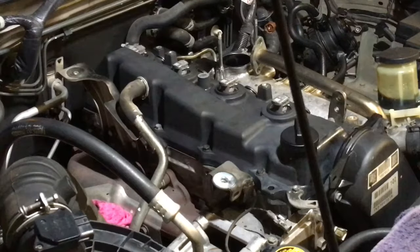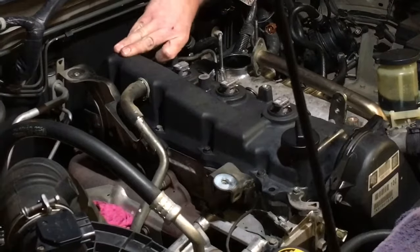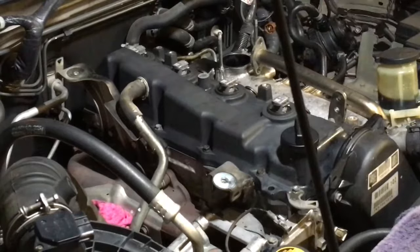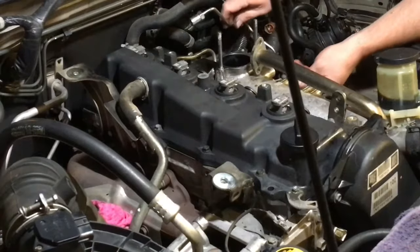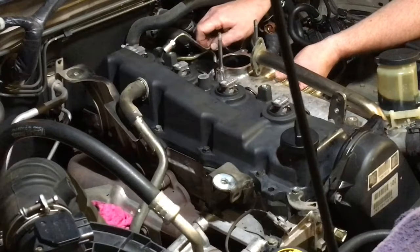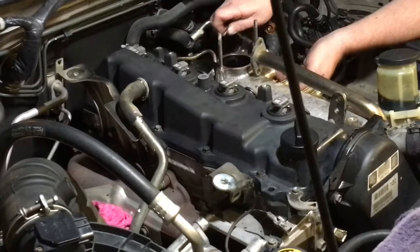So, push that number 4 nozzle seal in. Take off that number 4 cap off the common rail that we put on earlier. I'm glad we capped it because it's been hours of cleaning stuff. So, worth capping things. And then I usually like to sit it in place. These are quite easy to line up and everything, right? Now, did I get it right? Let me see. Yeah, I think I did.